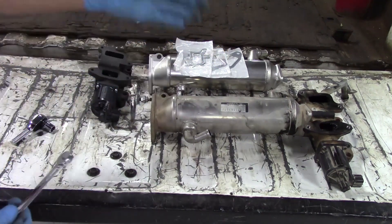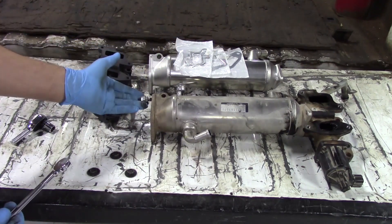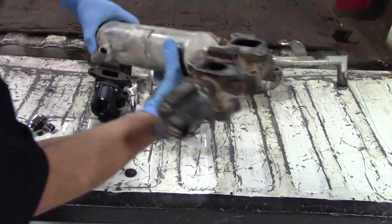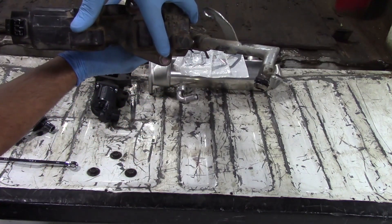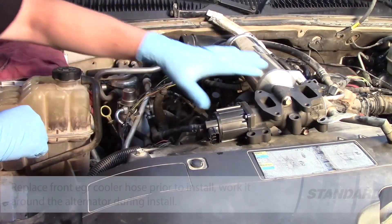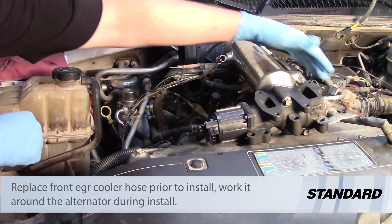Another note: we have some gaskets here, and before we reinstall everything we're gonna make sure those gaskets are placed correctly on the front side of the motor. We're gonna reuse these bolts and studs, get our gaskets taken care of, and then we also have one final bolt from the EGR that was not accessible during teardown. We're gonna take that out so we can remove this old EGR and reuse that bolt to mount the new EGR onto the new EGR cooler.